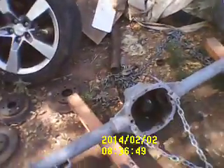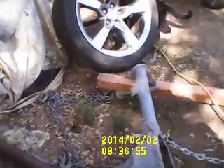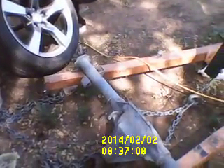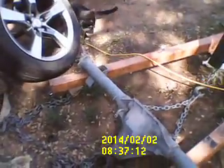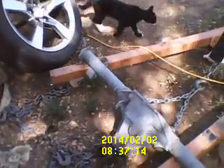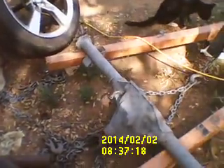As you can see, I've got it here laying on the ground. Turns out what had happened was the yoke wasn't on there, so it really wasn't that it was messed up or worn out. It was just that the pinion gear was loose and was causing it to lock up — it wasn't tight. So I ordered a yoke.